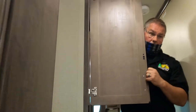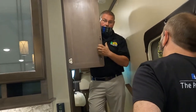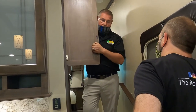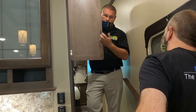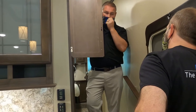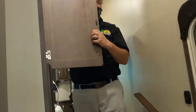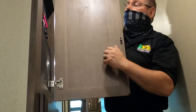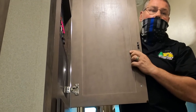The way that I've always done it is, well, there's the hot water method where you pour water on the side of the tank. The hot water method, yes. And then the other way is you look at the tare weight on the tank and you weigh the tank. That's the other way, but... Those are the two that I've always used. Yeah. The hot water is the one that's readily available. Yeah. You know, and a little bit easier to use. Yeah. Okay. Not that it's any more accurate, it's just that it's easier to use and you don't need a lot of tools to do it.